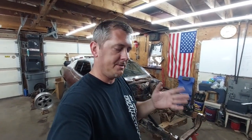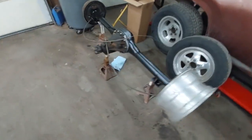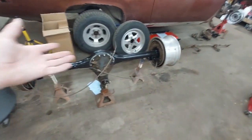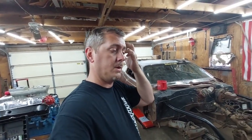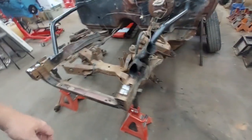They don't allow for as much deflection, so life would be better. In other news, the rear end is put together — went together nicely, didn't have any problems at all. Center section bolted right up, axle slid right in. It's got new seals, long studs — this thing's ready to go. E-brake cables, the shoes on these brakes even look good after sitting since 2016, when I pulled them off the '74 Dodge D100 because I was going to go to disc brakes. I knew they still worked really well, so now they're on here. I do have to change the wheel cylinders — they got a little rusty and funky looking — but not a big deal.